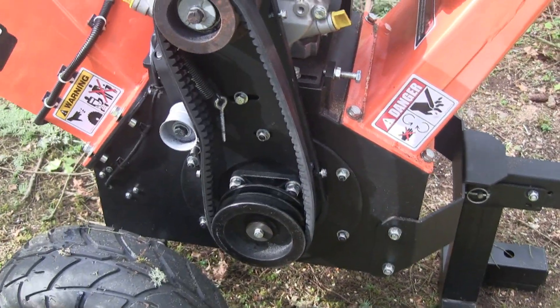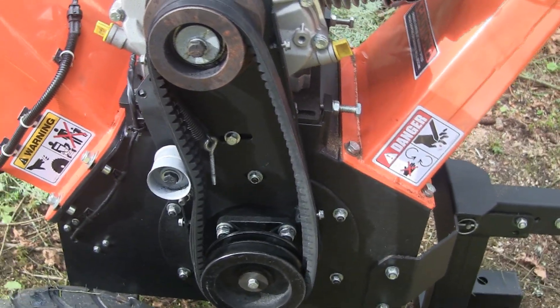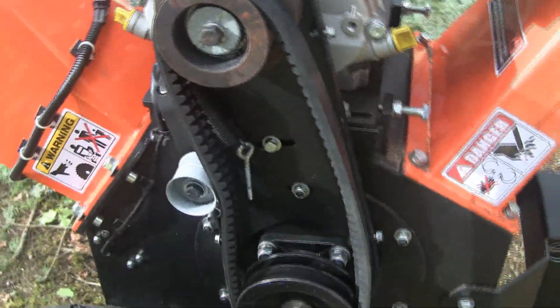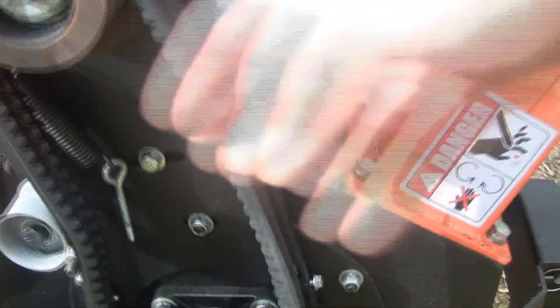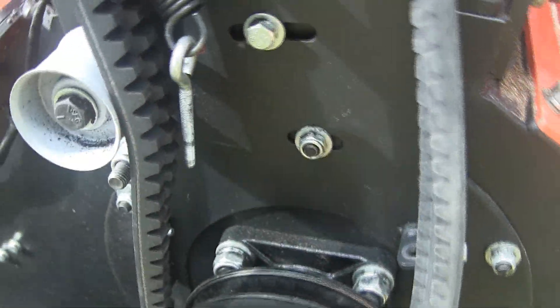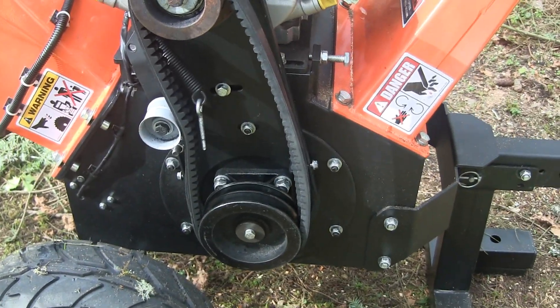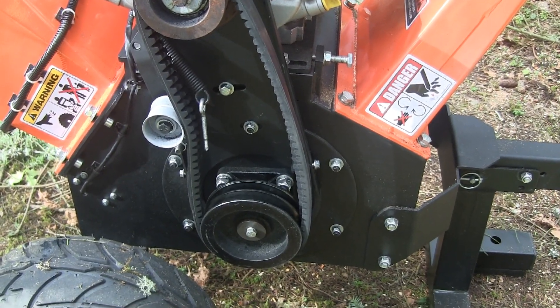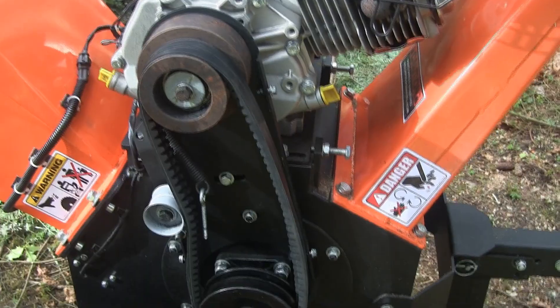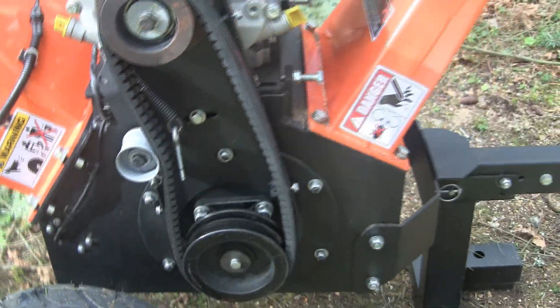They say to check the belts, and I do. But when I took off the cover, this is what I found: the belts were hanging in there, the idler pulley was way out of place — it was probably rubbing grooves in the housing from the belt. Then a nut fell out on the ground, and it's not even a nylock nut, it's just a standard nut. I got a new nylock nut to put on; the thing was full of dust. I don't know if my belts have been ruined — they don't seem to be in too bad a shape.